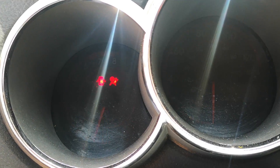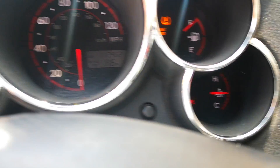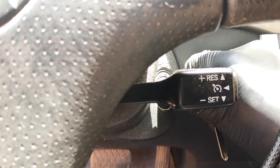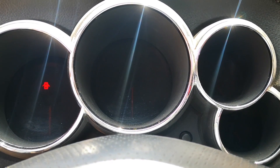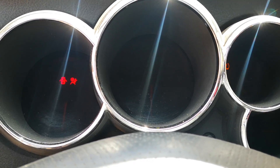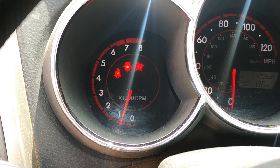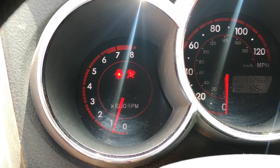Reconnected the battery. The car is now up to operating temperature and it's idling quite nicely. Here's how to do the idle relearn: shut the car off, take out the key, then put the key in and turn the ignition on. First time, turn it off — don't take out the key. Turn the ignition on again, turn it off. On the third time, start the car. Ensure the handbrake is on, put the car in drive, and leave it in that position for about five minutes. After that, your idle should be pretty much relearned.